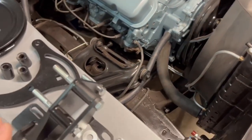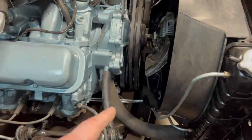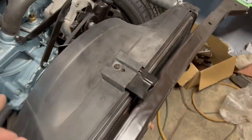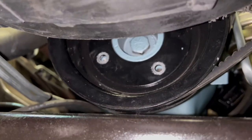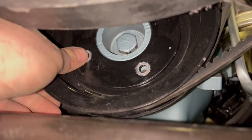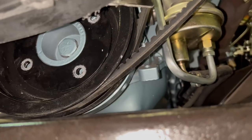I'm thinking we'll jump into getting this pulley installed first. I need to get down in here, pull the factory drive pulleys off, and put the AC pulley between the balancer and that pulley. Additional note: I never did tighten the belts up on this car — they're really loose and sloppy — so you'll have to back off the alternator and power steering if equipped. Down at the very bottom, I've got the four bolts out of the balancer pulley. One, two, three, and four are out, so I can actually pull this pulley off the crankshaft, slide the AC pulley in with the belt, without taking everything else off.